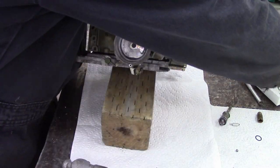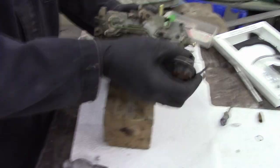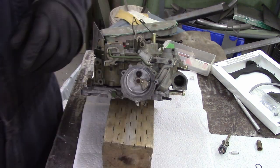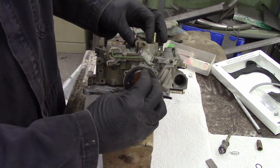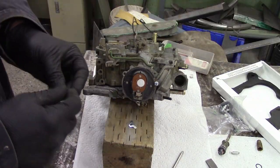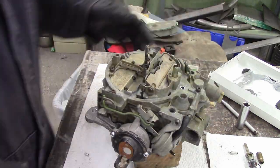There's the screwdriver prying the pin back into place. I want to make this choke adjustable — I got a new gasket and drilled out the holes with a number 23 drill, and the kit came with self-tapping screws. But when I set it in place I found it locks and I can't adjust it at all. So I did what needed to be done — hammer and chisel — and took out that little stopping block. Now I can adjust the choke wherever I want. Since these go on shop engines that kids work on, I want the choke off so it doesn't flood and is easy to get going. New screws, original hold-down retainer, and air cleaner stud.